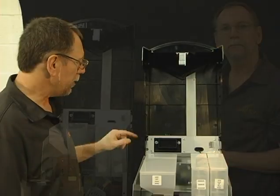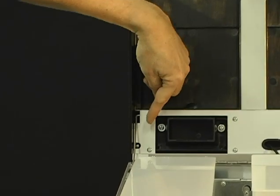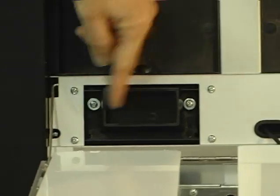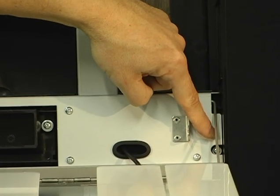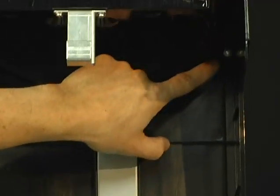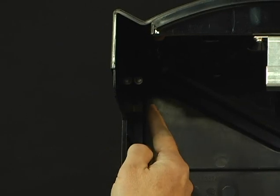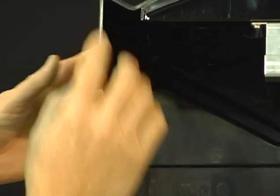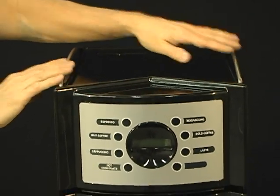So let me show you where I have the four screws and washers installed for the two rods on the front lid. The bottom left corner, bottom right corner, top right corner, and then the top left corner. And there's the two rods installed on top